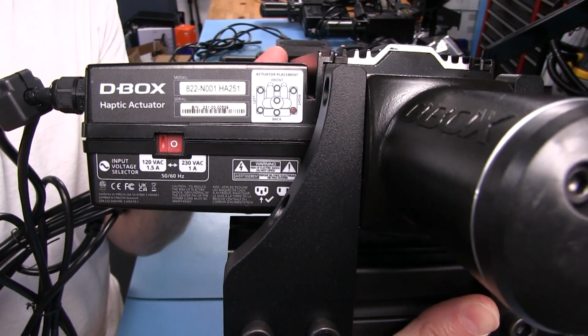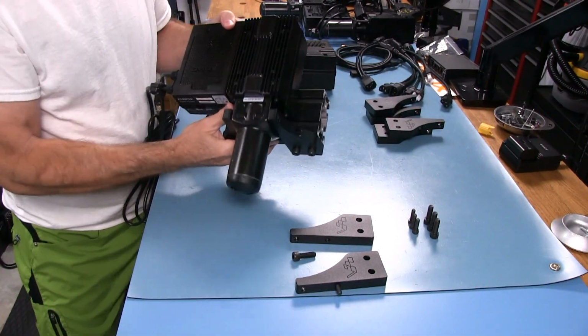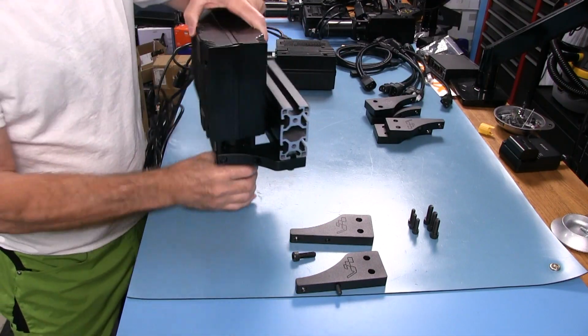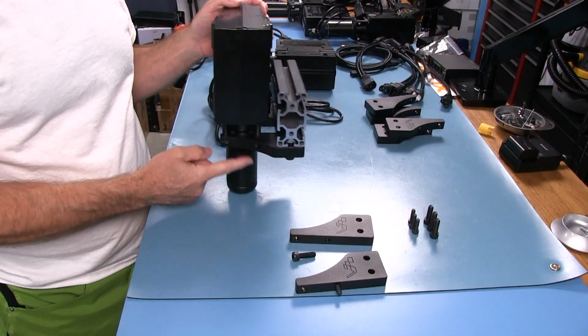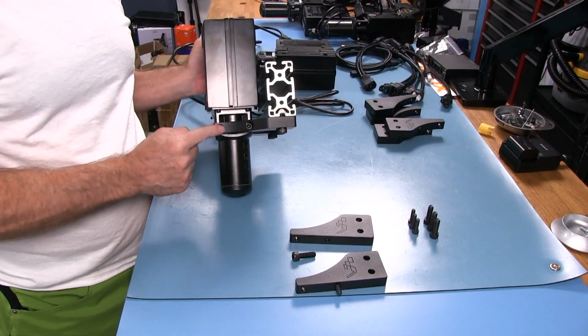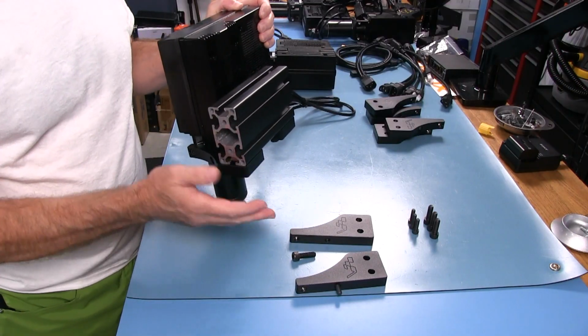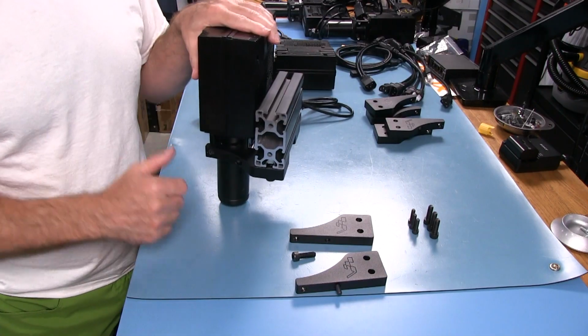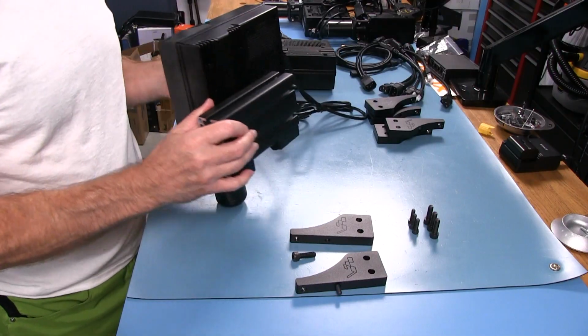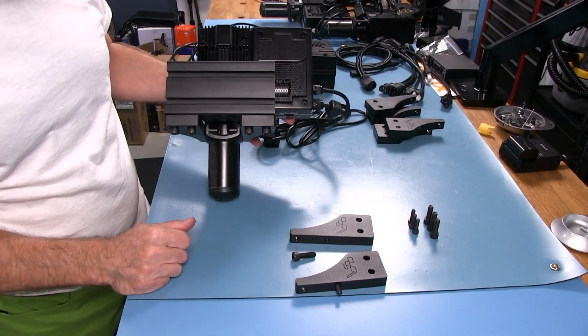So right rear, it doesn't matter the orientation of which way you flip it though. So you're okay there. So this is actually pretty tricky, I think. You know, torque this down into your housings, the M6 bolts we have in here, and then just slide it down where you need it and then go ahead and tighten everything up. Probably the easiest, less fiddly way to get this done. And yeah, I think this is going to work out pretty well.